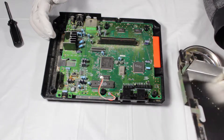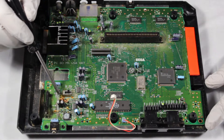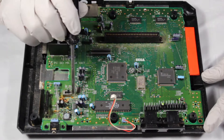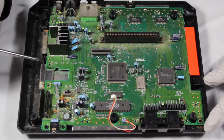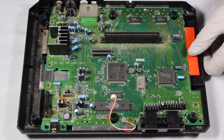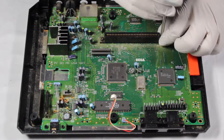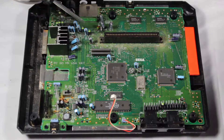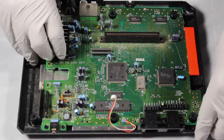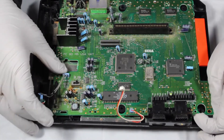Given the way the dust has kicked on here, I'd say someone's time out has lasted a bit too long. Upon further inspection of the board, there appears to be corrosion at the base of the power switch. How unfortunate. We'll be dealing with that later. Let's get the board out by removing the black screws holding the cartridge slot down.